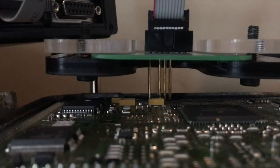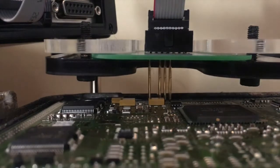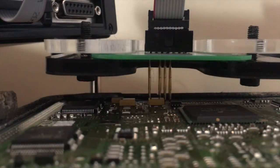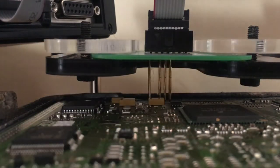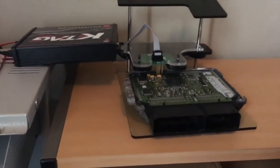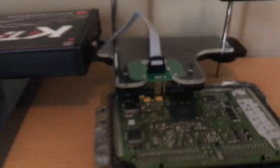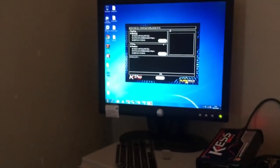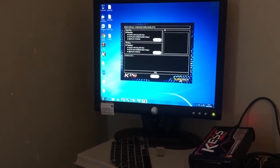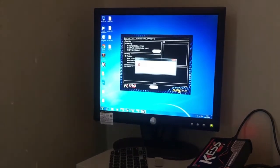I have an external power supply and it needs to be at 15.9 volts, so I'm going to set that now. Theoretically it means I should be able to read the ECU. Let me show you from the computer side. I changed the ECU position so you can see it even better. You can see pin one there. Let's see what it does if I try to read - press the read button - it will try to identify the ECU and it doesn't work.